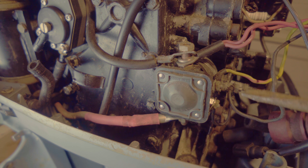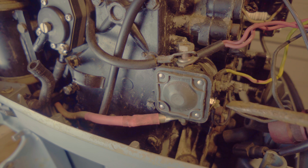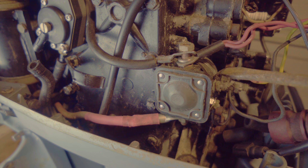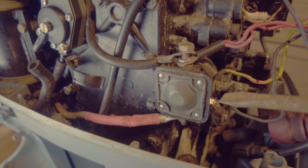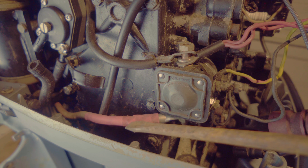Now two things to check — there are two wires here, the positive and the ground. For example, if this wire here falls off, your engine will not start because there will be no power sent to this top screw, which would turn on the relay and send power to your starter.